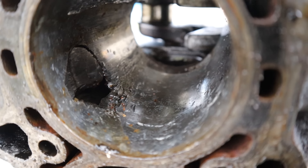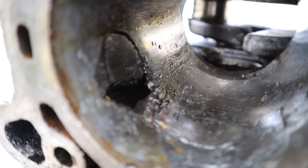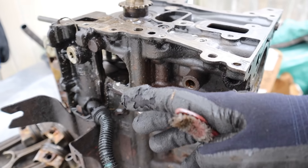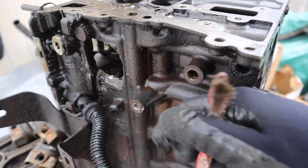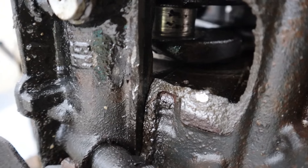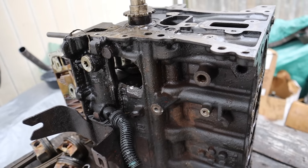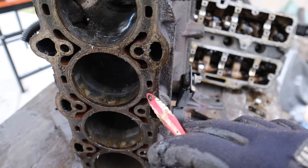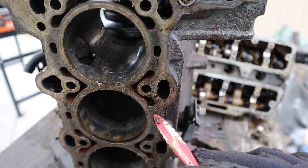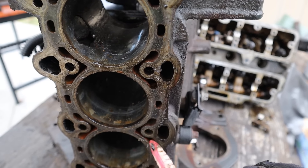Here's a closer look at the carnage inside of the cylinder that failed. You can see it pretty much punched a hole right through the water jacket over there. It also punched a pretty big exit hole — at the front here there used to be a bracket that held the AC compressor, and that's what's kind of hiding this little hole. You can actually see directly inside of the engine. That's pretty impressive for being an iron block. Now also with the iron block, you'll see that they use a semi-closed block design, which is going to lend for good strength because you've got all this material in between the cylinder and the housing. However, not so good for cooling.